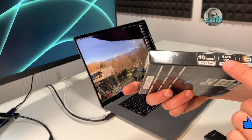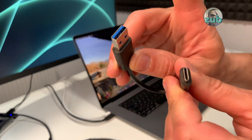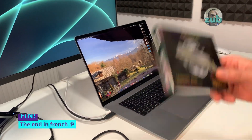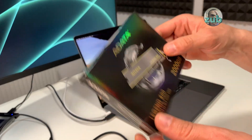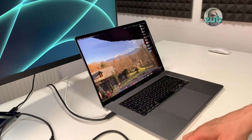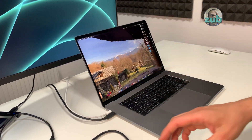By the way, you will get 10 gigabits per second only if you use the USB-C to USB-C cable. With the USB-C to USB-A cable you will get only 5 gigabits per second. The key learning here is that you will not be able to reach the full speed of an M.2 PCIe SSD with an enclosure — you will get only the fastest speed the enclosure supports, provided you have the hardware for it.